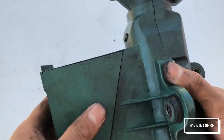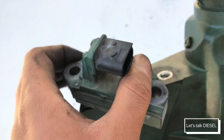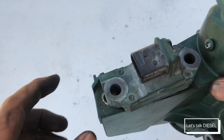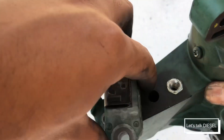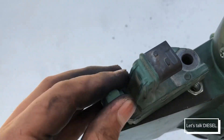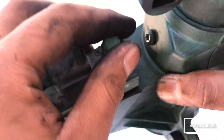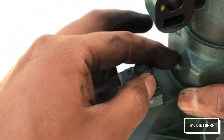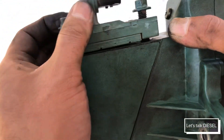And there we have it. Now the last touch — the sensor. Don't worry: this sensor will not fit all the way in one orientation even if you try. That's the reason why they designed this corner shape, so this part will not fit incorrectly. Turn it around and it should fit. Put the 2 x 10mm screws in here and tighten them. Make sure the o-rings are in place too.